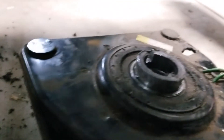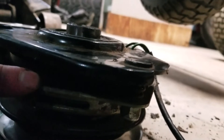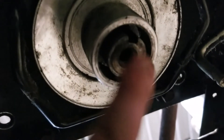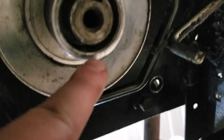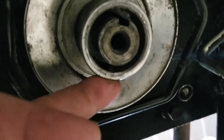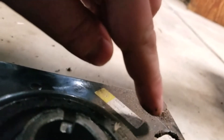Now this next piece - the belt drive pulley, and then the clutch engagement for the belt. There is a little notch and a keyway. Those line up corresponding to the crank pulley - keyway lines up with keyway. And then the little notch lines up with a reverse key pressed into the pulley on the inside. Be sure you line that up right, otherwise it won't fit right. And then this little pin notch, which usually gets worn out like crazy, goes in that hole. When this engages, it kicks over - and that usually wears out. Mongo get pulley on - pulley connected.